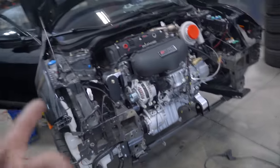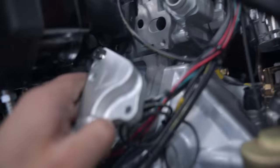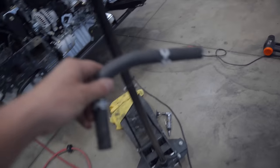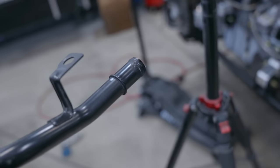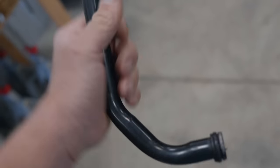Injectors are sorted out. The next system I'm going to tackle is the cooling system. The first thing we have is this K-tuned little thingamabobber — this guy's going to sit right up in there, and then this hose is going to go underneath the intake manifold and connect way back there. We got all that installed. Next up is this hose — I guess you'd call it a heater core hose — so that goes to the heater core.